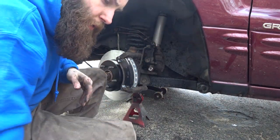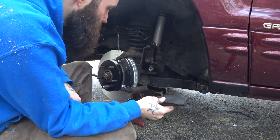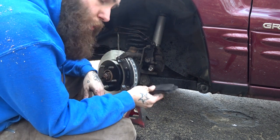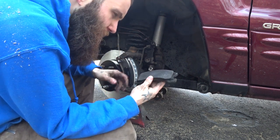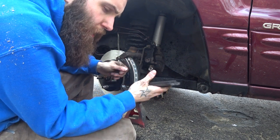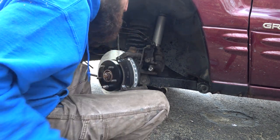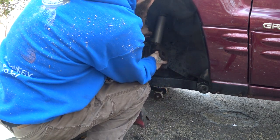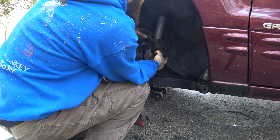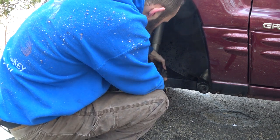Now you may be wondering why I'm not reusing these brake pads. First of all, the conversation we just had — they're too hard, I think. I think they warp these rotors for this Jeep. Additionally, you wouldn't believe how violent the shaking was. I wouldn't be surprised if there's not some micro cracks in here. All I need is these bad boys to bust apart. I already said my Wearever Silvers were all of $16 — I'll spend $16 for the peace of mind when I'm driving the junior monkey with a toolbox to daycare, to know that when I go to hit the stop pedal, the stop pedal is going to stop me.